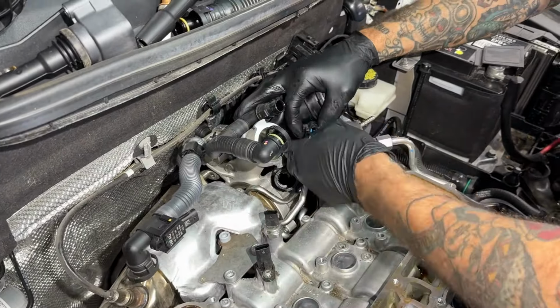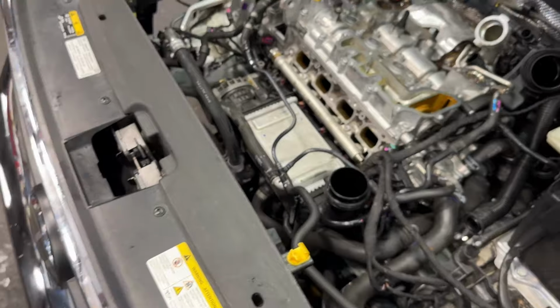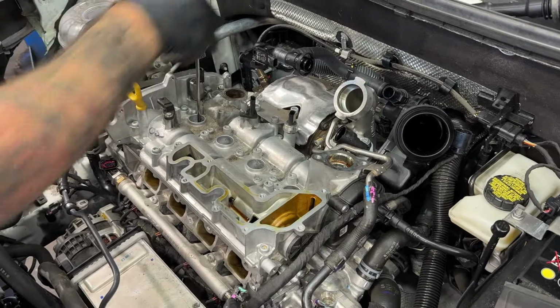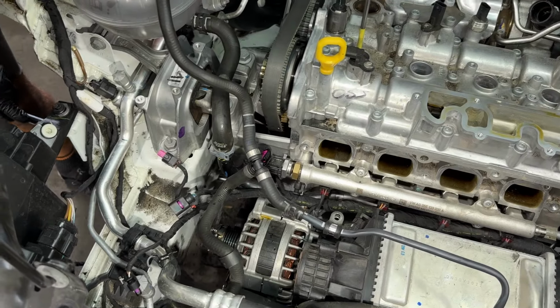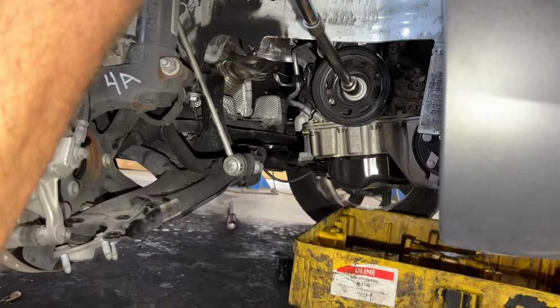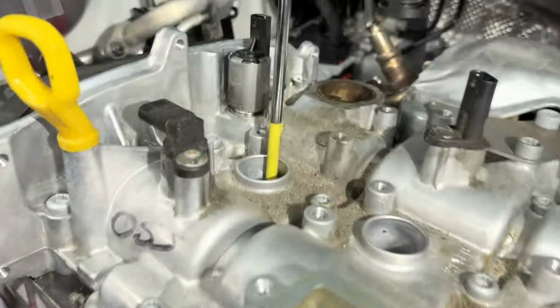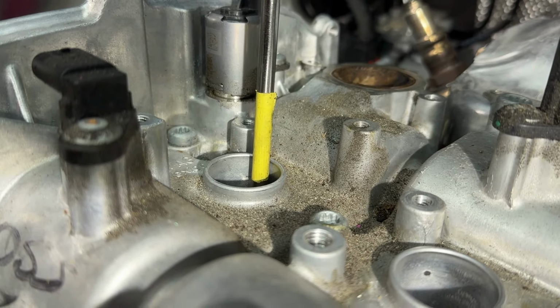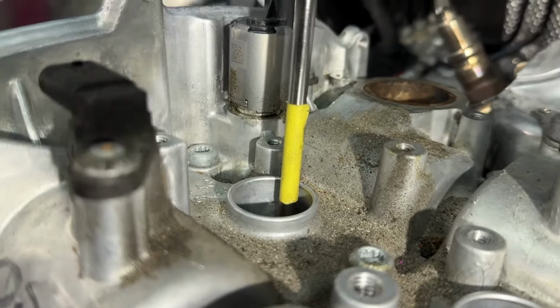About 164 millimeters off the screwdriver. So what is that doing? To find top dead center pretty easily. Stick that in there. Put in 12 point. Slide it around a couple times here. We're gonna get her close and raise it up.